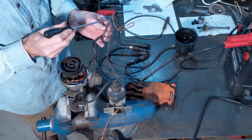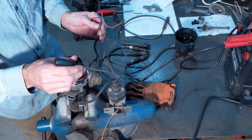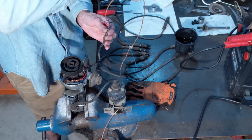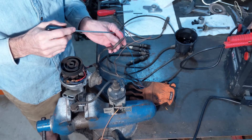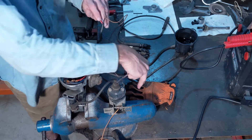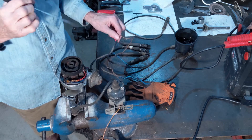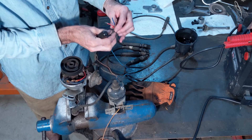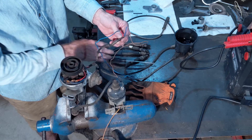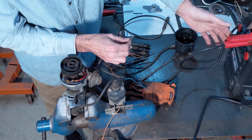And the battery wire I've got right here. The battery wire I've got wired together with the wire going to the positive side of the coil. And the red wire I have wired with the wire going to the negative side of the coil. The battery wire and the positive side of the coil wire I'm going to hook together with my jumper battery to 12 volt positive.